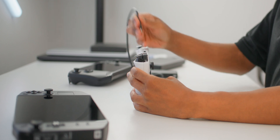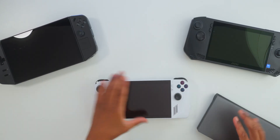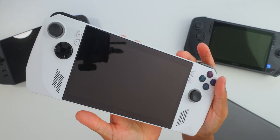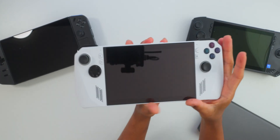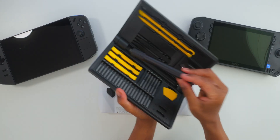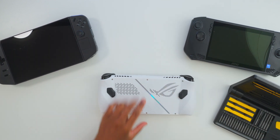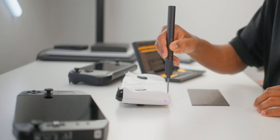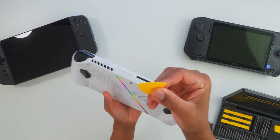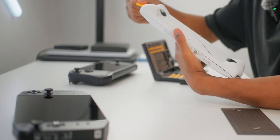We're back after that lengthy cloning process. Let me share the process of opening up the ASUS ROG Ally. The device is off — press the power button, nothing on screen. We grab our precision screwdriver and remove all six screws, except for one which locks in and doesn't come out. The easiest way to open it is via a pick — nice and smooth.